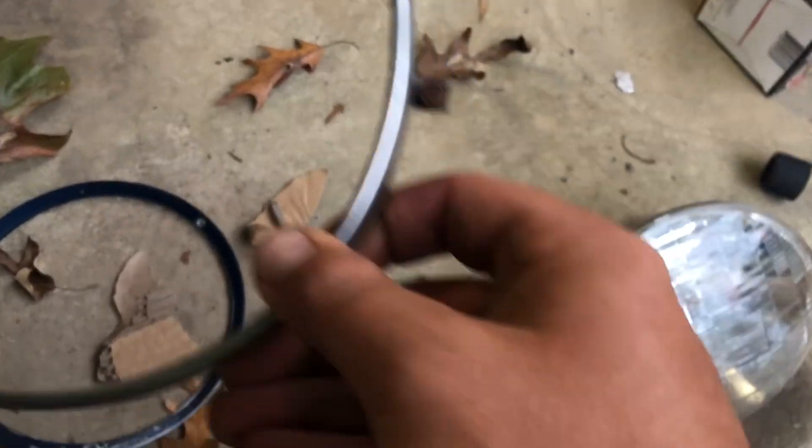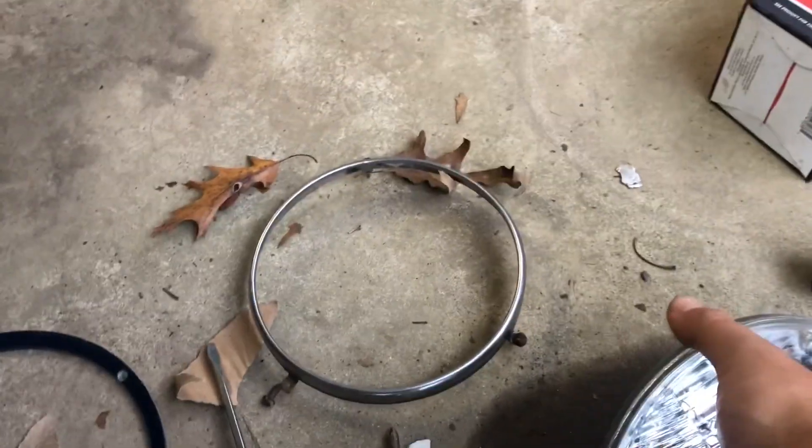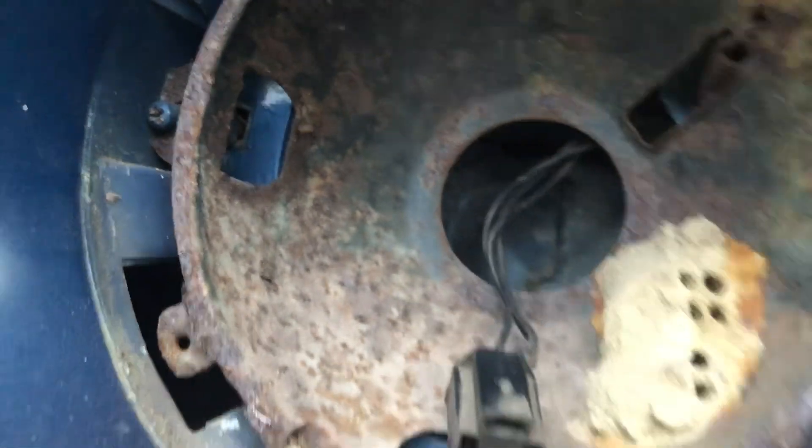We'll pull it out and figure out what's going on. What I've found is these other ones in here are for adjustment — you've got the adjustment screw there, the adjustment screw on the bottom, and then this just plugs in. This is a sealed unit. So what we'll do now is go get my tester and stick the prongs in here, see if we get any power anywhere. That'll tell us if we have power coming to the front, and then we'll know that these headlights are, in fact, bad. If not, it'll be tracing down these wires, trying to find out where they go and getting power back up to here.